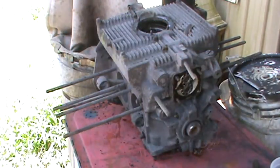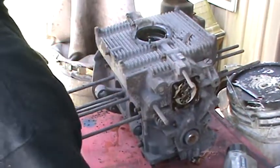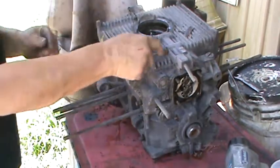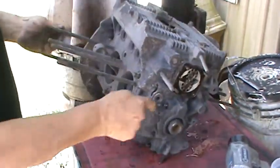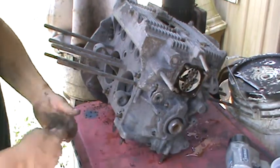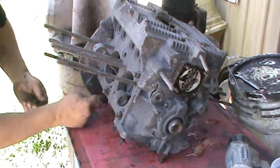Make sure you got all your bolts — I think we got everything. I'm going to go over with the magnet and get the washers off. We won't use any of these washers, not on the motor anyway — these are all flats. There should be spring washers on a Volkswagen to hold the torque in place and keep stuff from vibrating off.